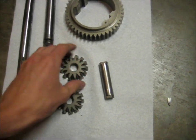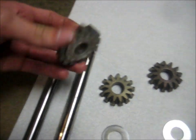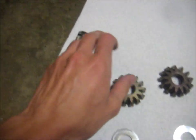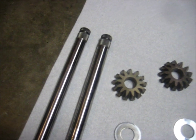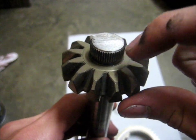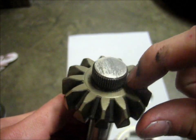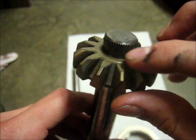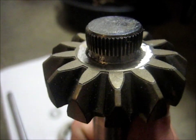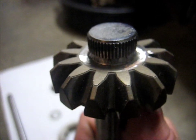What I'm going to do is remove - at the end of the axle inside the differential there's normally the spider gear with the splines, and then it's held on with two circlips. So we're going to remove the circlips by welding it. I'm going to lay a bead of weld right in there. But before I do that I'm going to grind off this hard-faced coating - the hard finish - just so that the weld penetrates better. You can see there's hardly any material removed, it's just taken off that hard finish, and then you're ready to lay the bead down in that corner.